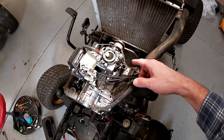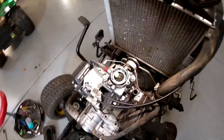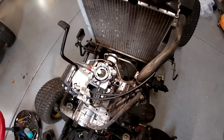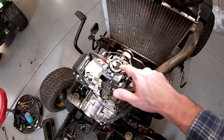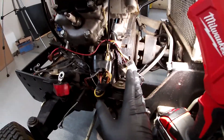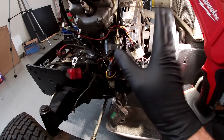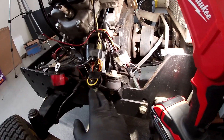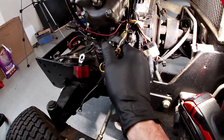Now I've got everything off that I think I need to get off. I went ahead and just used my vacuum and an old toothbrush and dry brushed a lot of the dirt away. That's going to be a lot easier than trying to soak everything with degreaser and hosing it off — a lot less messy. I've got to make a cover for the carburetor throat to make sure I don't get anything down in there. I got the choke plate closed with an earplug through the vent. I've made another executive decision to remove the wiring harness from the engine in order to clean it. I've got engine degreaser — just the traditional type — and it warns about wiring and electronics, so I thought I better play it safe. Looks like there's just one harness, so I'm going to try to follow the routing and figure out how it goes on so I can get it back on when I'm done.